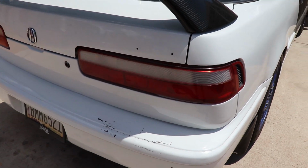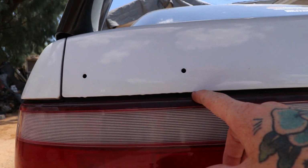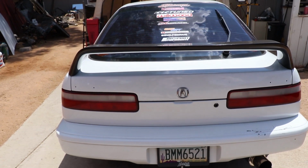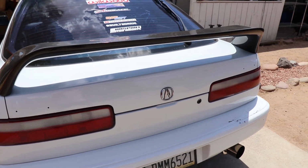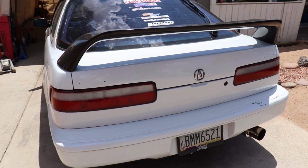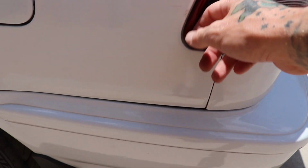And I usually do forget about it until I'm walking around the car and I notice it. So I've also got lots of runs along the hatch here. The only issue that we really ran into is, last time the car got painted, I had paid the body shop manager at my dealership I was working at the time to spray it. And I'm sure he rushed it because it was just a weekend gig for him. He was just trying to get in and out really quick. But mostly the booth was having heating issues, so the booth was not at the optimal temperature and just wasn't all around right. So we got runs there, we got runs on the other side, runs along here.